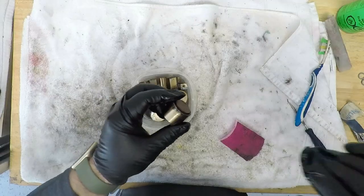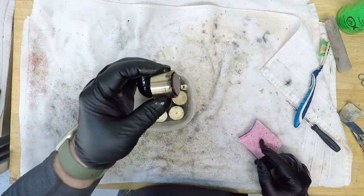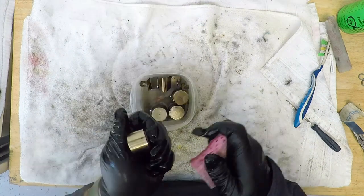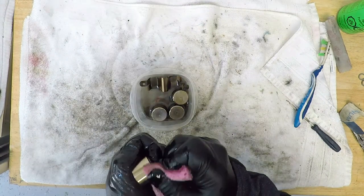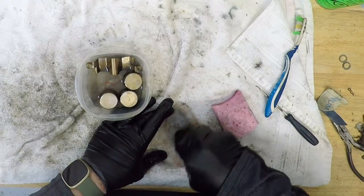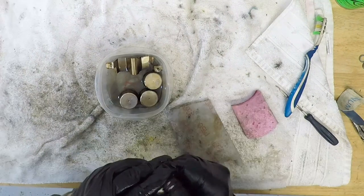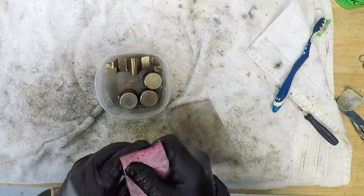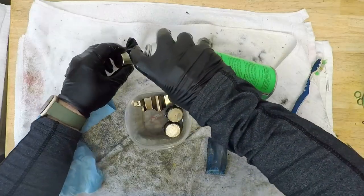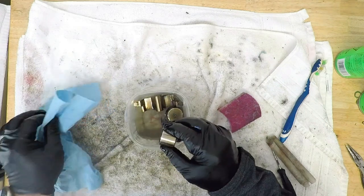The more difficult cleaning job, however, is actually on these pistons. You can't have any deposits left on the pistons, or the brake pads will drag on the rotor. So I make sure that they're not just clean, but smooth, without any scores or burrs. Any rough patches or areas where the carbon has baked onto the piston and I'm having trouble getting it off, I use some emery paper to loosen or smooth the surface. Then back to the scrub pad to finish cleaning them up. When all the baked on crap is removed from the pistons, I finish with brake clean and a fresh shop towel to wipe them up.